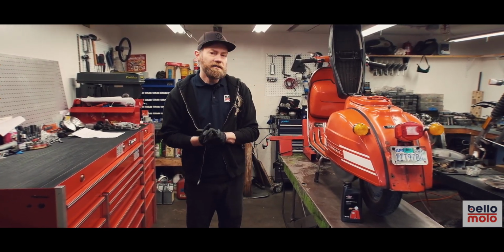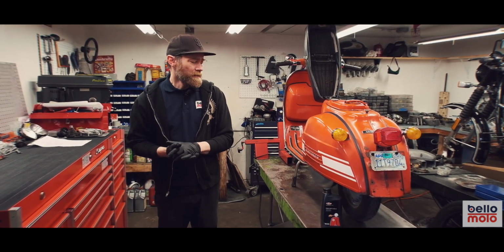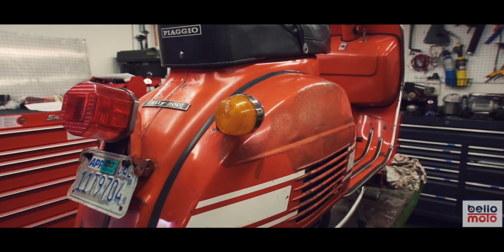Some of the older models of Vespas had a greater ratio. The piston-ported models, like the GS160, SS180, those were recommended to be at 5%. With the modern synthetic oils, you can go down to 4% without any problems. But originally, those were recommended at 5%.